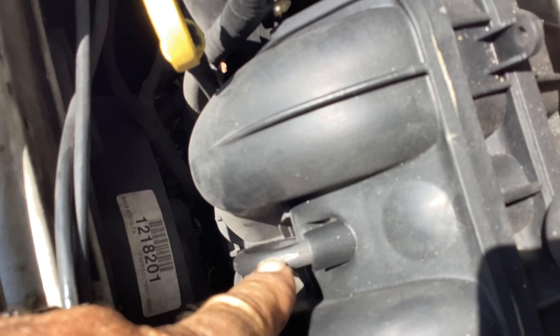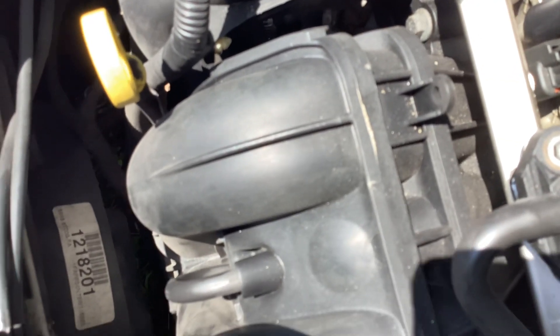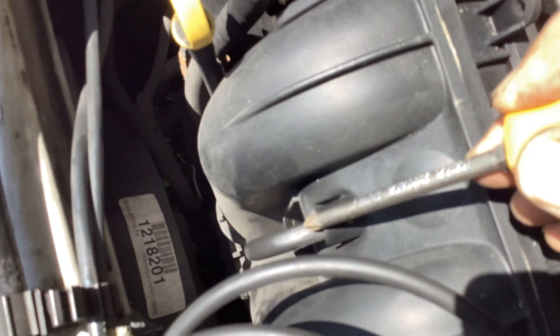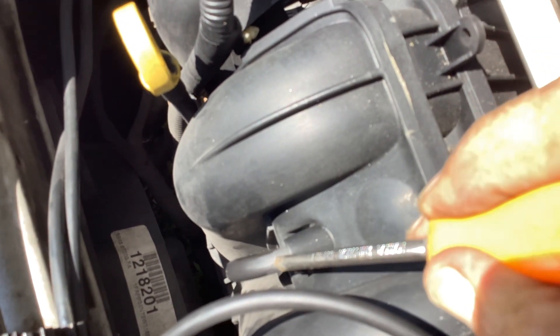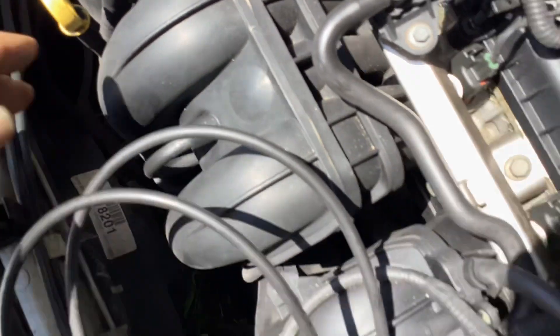In the center there's a huge crack right there, so that could create an issue. If this is vacuum operated and you have an outside air source, it's not going to actuate these flaps. So there's a small split there.